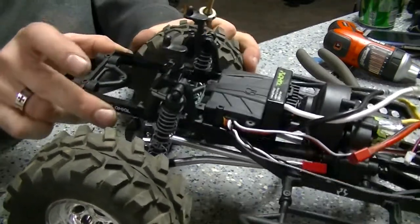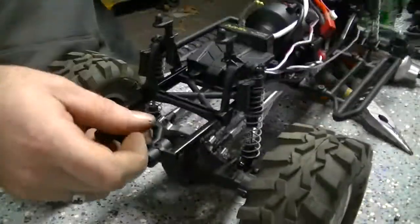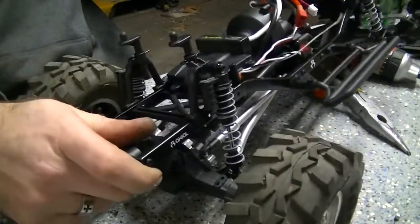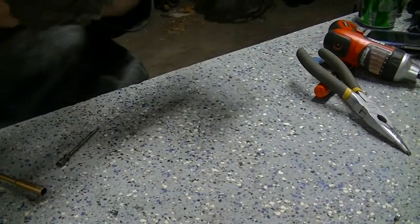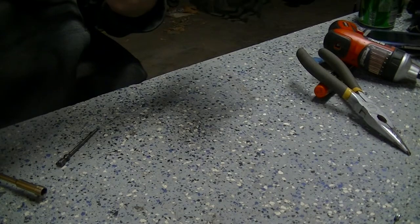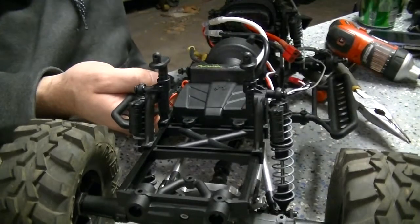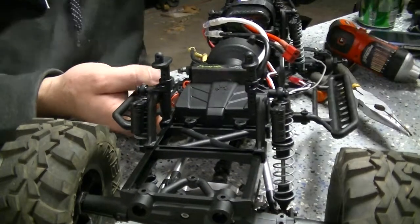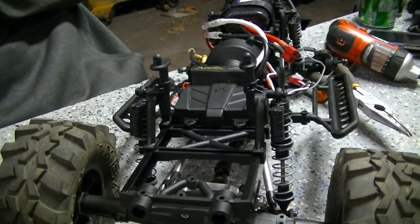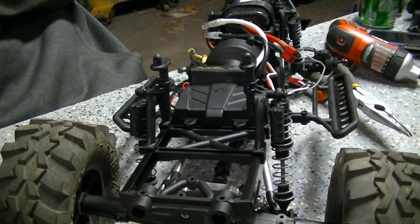And there you have it. There's your rear four-link kit on. Still has good flex. But the only thing that I would do is, I'm wondering if, see what happened here. Yep, I put the freaking links on backwards. The lower links are on backwards. They're supposed to be the bent ends up front. That's why they're touching each other.